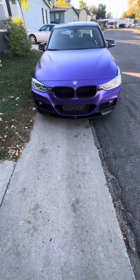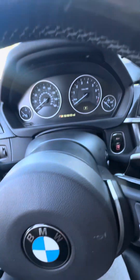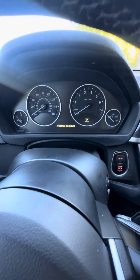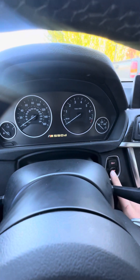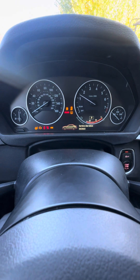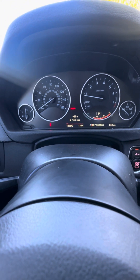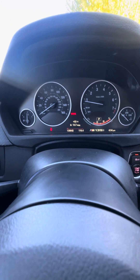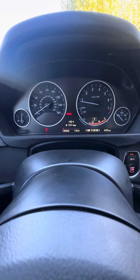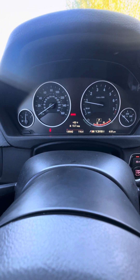It's actually the next day and I got to drive it quite a bit — I put over 100 miles on it. With my old pump it was actually starting to fail; in the morning when I would try to start it there would be a slight delay of like five seconds before it would start, which just means your fuel pump is going out. Now with the new pump there's no delay — it starts right up. The N55s have really weak fuel pumps and this was only running E20 before, which is not that much for a BMW.